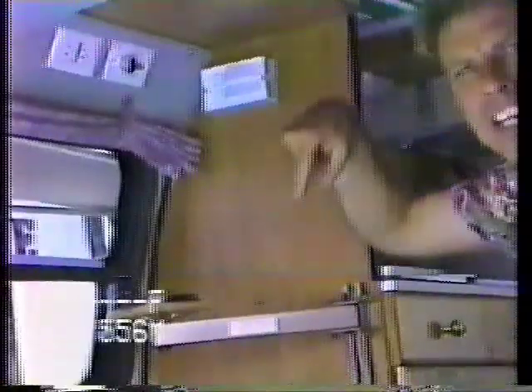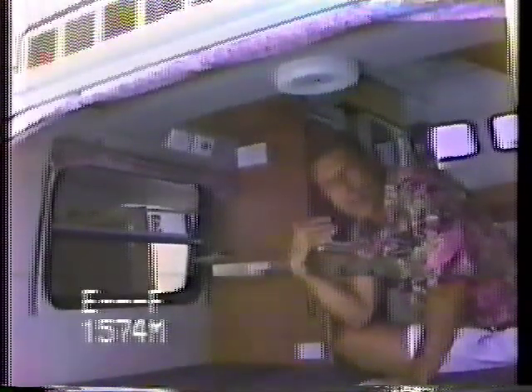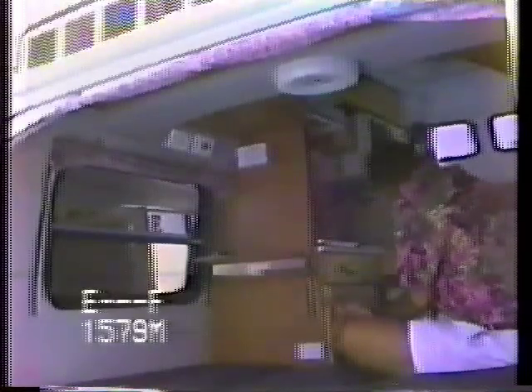This is a carbon monoxide detector — it will detect carbon monoxide in the air. The carbon monoxide detector up here and the propane gas leak detector underneath should be left disconnected when this is being used as an everyday car. Fluctuations in power or emissions from an old truck or car next to you can be picked up and they start going off while you're in the front and can't do anything about them. So disconnect them, and when you're stopped at your campsite connect them and use them.